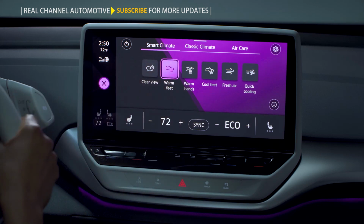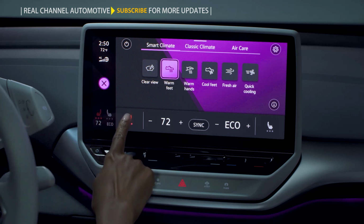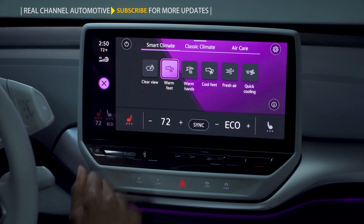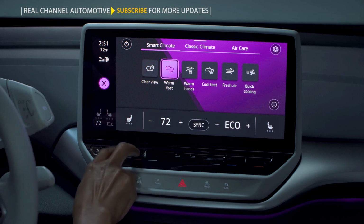Also in the climate screen, you can set seat heating to one of 3 levels by cycling the button. The heat level indicators will appear under the icon. You can also control seat heating by tapping with 2 fingers on the temperature touch slider under the infotainment system on either side.